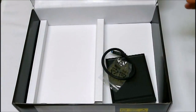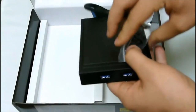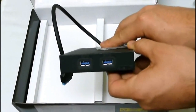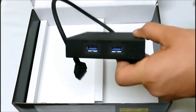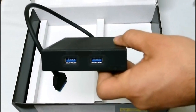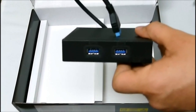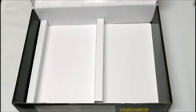One of the better things included is the front panel USB port. This plugs into the front pin header on the motherboard, and the panel itself slides into the 3.5" external bay on your case. So if you have a case that supports a 3.5" external drive bay, you can plug this right in and pop the cable on your front pin header. That gives you an extra 2 USB 3.0 ports on the front — or if you'd rather have all 4 on the front, you can plug in all 4 there. And that's the P8Z68 Deluxe motherboard from Asus.